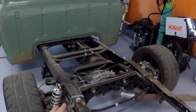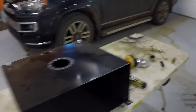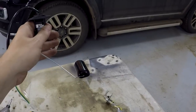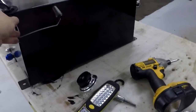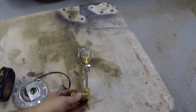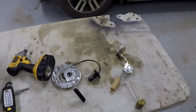The first step is I'm going to have to take that apart and then get my fuel cell and try to see how it fits in here. Now, one thing I noticed when I started looking at the fuel sender is this is the sender that was inside that China fuel cell, and you can see how short the float is on it. It would have probably told me the tank was full at about three-quarters and empty at about half, because this just doesn't have enough travel. They would be full and they would be empty — not even down to half. So I have this extra 1970 Mustang fuel sender, and I'm pretty sure I can take the arm off of this one and attach it to this one, which should give me a bit better range for how the fuel gauge reads.